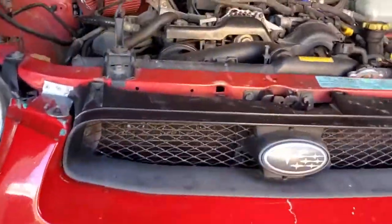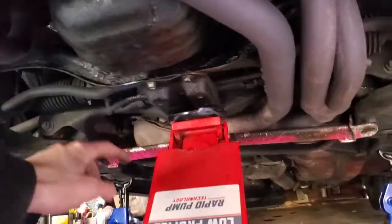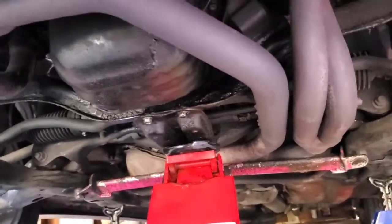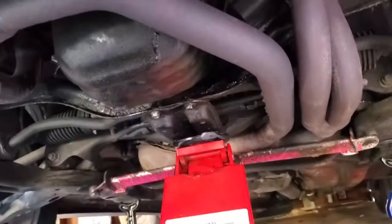When it comes to lifting up a Subaru, we're going to lift it from the front. Right past the oil pan, which is right here, you have the cross member. You should definitely do it more centered on it. I kind of just had to get it and lifted it up. I always put jack stands underneath — I'll go to the side and show you where to do that.